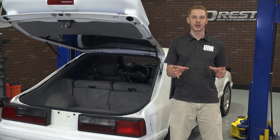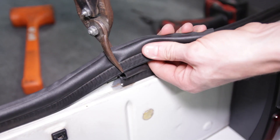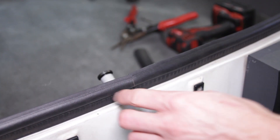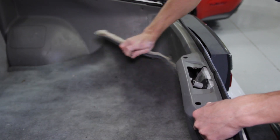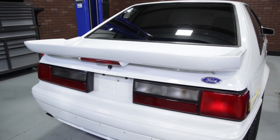Make sure there are no wrinkles in the corners. Once you make your way around the entire hatch area, take some quality wire snips and cut the weatherstrip even with where you started it. Place a small dab of weatherstrip adhesive around the seam where the two ends come together. Reinstall your panel and allow the adhesive time to dry.